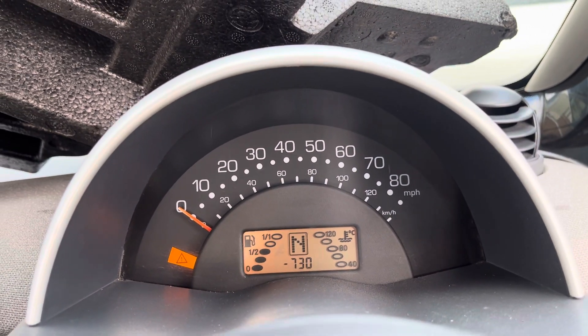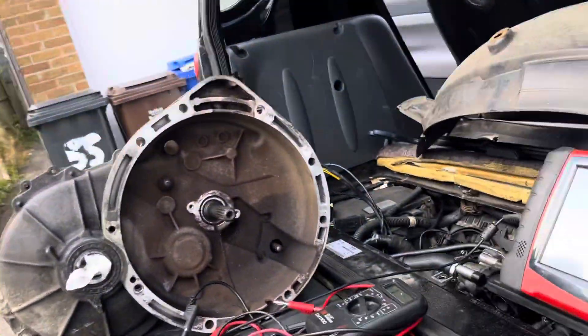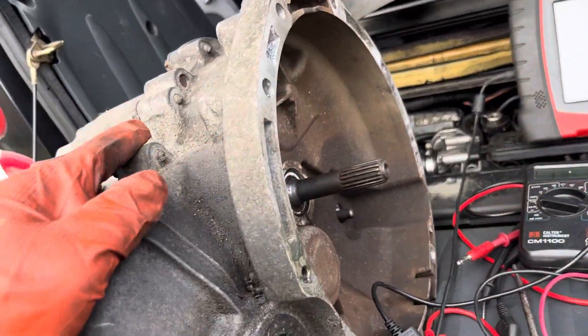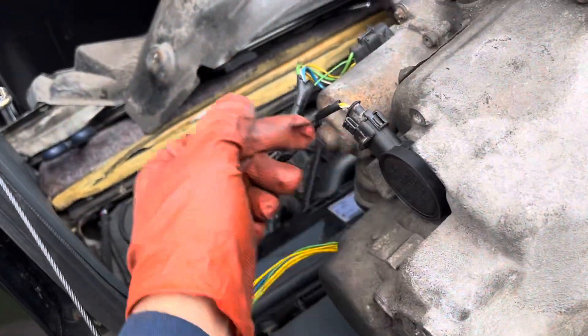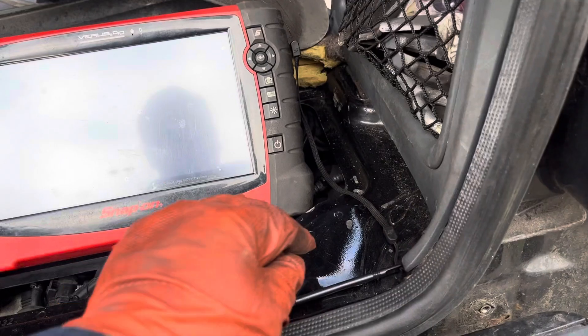It has started. It is running rough at the moment because I've actually got the air intake pipe disconnected, as you can see there — that's the reason why it's surging. So yeah, even though the gearbox is out of the car, I've just connected up all the relevant sensors and motors and did the gearbox transmission learning.